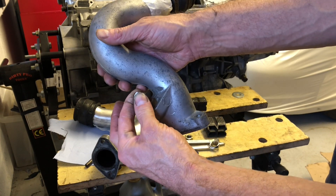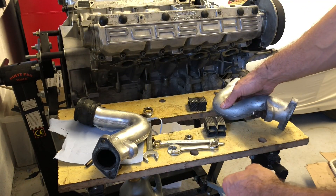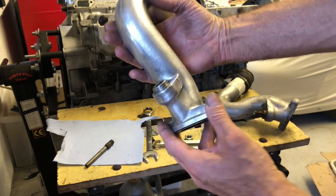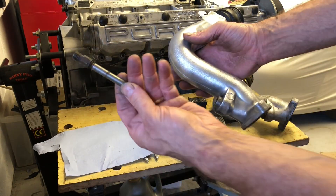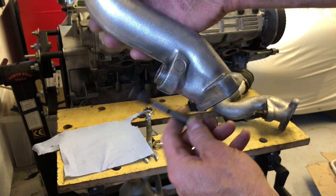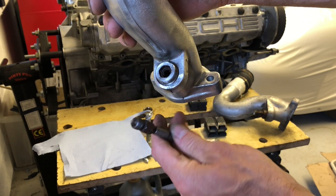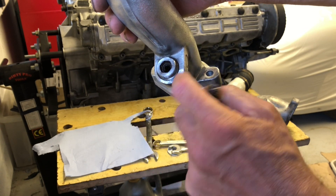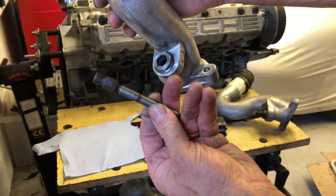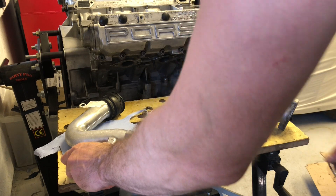Online there's mixed videos and it just isn't clear exactly what's got to happen. But if I show you one that I've got here - this is one I've already cleaned up, and that is the injector I took out of it. So that injector is effectively pressed inside that hole. There's a rubber sort of grommet that it sits in - a seal, or whatever you're going to call it. And there's an aluminium seat that I need to take out later, but the goal at the moment is to get that out. So how? Let me show you.